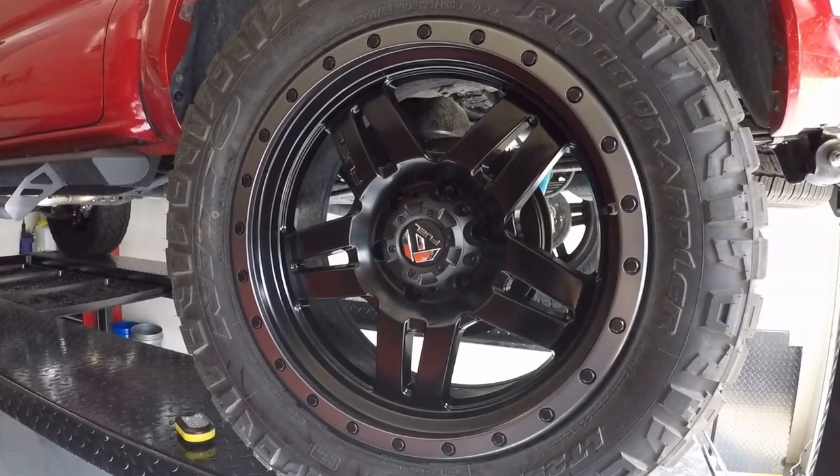Secondly, comfort. I hear from people that try to tell me that lifting their truck made absolutely no difference. There is one caveat — that might be true if you didn't change your tire setup, because it's not really the lift altogether that changes the ride quality. You are going to have a little bit stiffer ride. If you're compressing the shocks and springs, your truck is going to ride a little bit firmer than it did before. But once you throw those bigger, meatier, more aggressive tires on there — especially if you reduce the sidewall, like going with a 20-inch like I made the mistake of doing — it's going to make a big difference. That truck is going to feel everything on the road, and it's not pleasant.